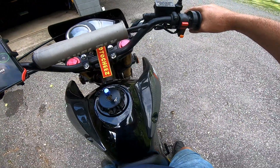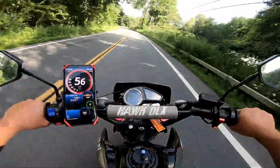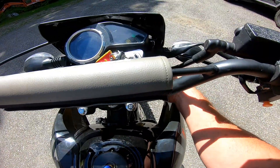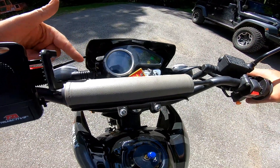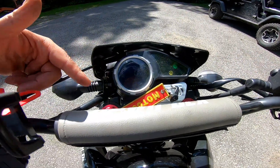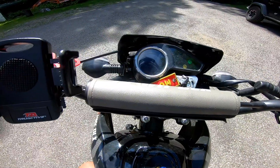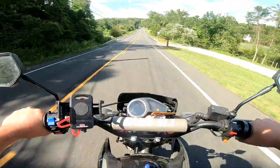Put the speedometer magnetic pickup sensor back on. I don't think it's going to work — I spun the tire and my speedometer's not working. I guess I broke my speedometer. I should see if it's sending power down. I think when those wires were pinched, my splicing job may have shorted out because I'm not getting a full 5 volts or 4.9 volts to feed that pickup. I tried injecting voltage to it and spun the wheel and still couldn't get any speed. So I may end up getting that universal digital speedometer I used for the Raven down in Florida. I already have my magnet sensor so I should be able to do that — I've tried a bunch of them, it seems to be my favorite. Easy to hook up, easy to transfer, and it seems pretty safe.